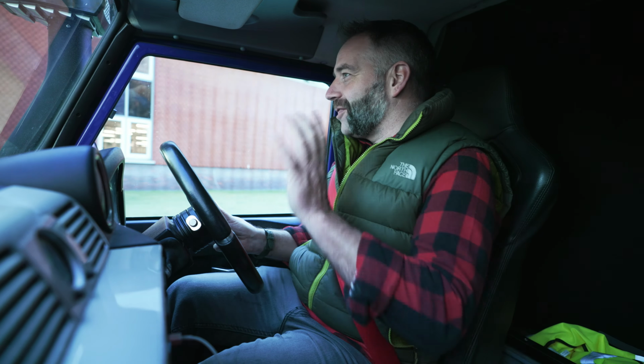Normally in a Tesla this is just driving the rear wheels. What we do is we turn it through 90 degrees and mount it up between the chassis rails, where the transfer box was, using the original gearbox mounts and holes that are already in the chassis. Then this goes off to the front, so that's the front prop, and that's the rear prop. So you've still got four-wheel drive. We also have a limited slip diff in there to help with off-road. But all that has to be controlled, obviously. So what we do is we spoof it, or fool it, if you like, into thinking it's still in the Tesla.